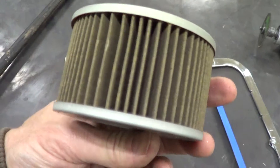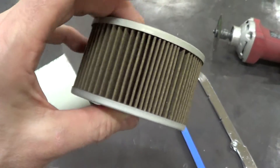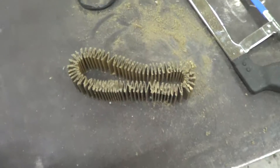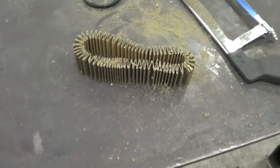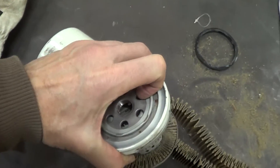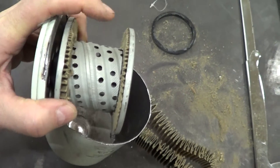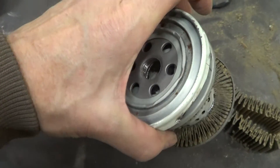The filter isn't obviously horrifying, but if there are a lot of little particles clogging up the 10-micron holes, you might not see those particles and the filter would still be clogged. The hacksaw was useful in chopping off the paper filter, and you can see how it actually works: the fuel flows in through the outer holes, into the gap, then through the paper, through the barrel, and back out the threaded hole in the middle.